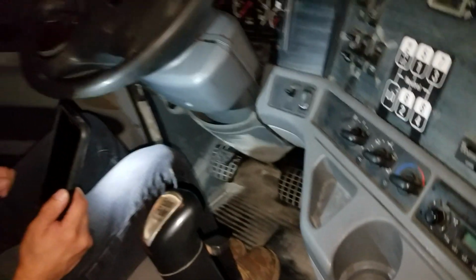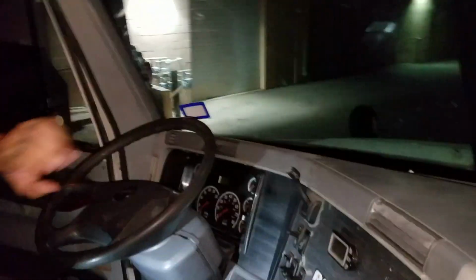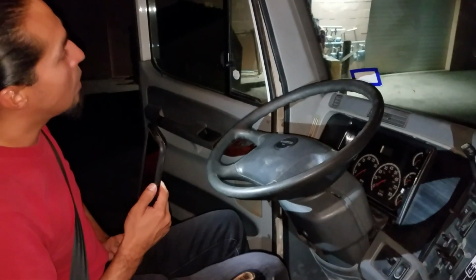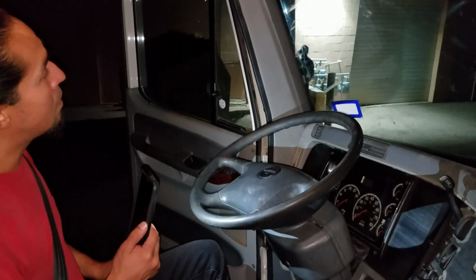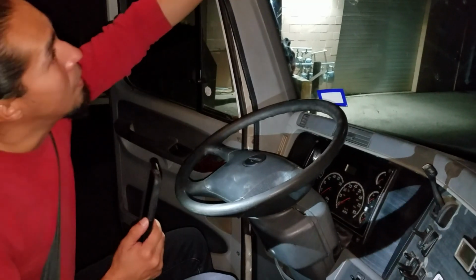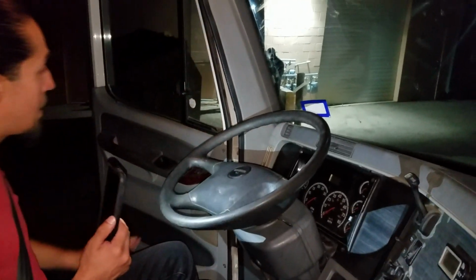And now I'm gonna go ahead and check my windshield. I'm gonna start with my left and my right, not cracked or broken, always clean, free from any stickers obstructing the view. Only sticker I'm allowed to have, as I mentioned earlier in my picture, is my license plate up to date. Weather strips both sides, left and right, no signs of any leaks. I got my sun visors in good condition, working properly, not cracked or broken.